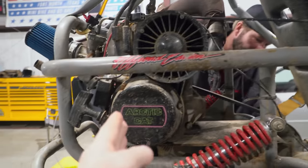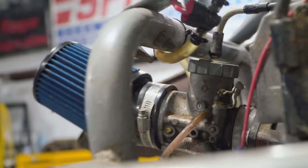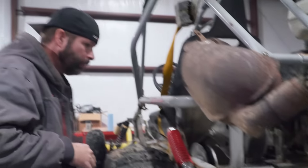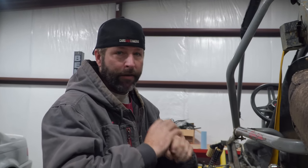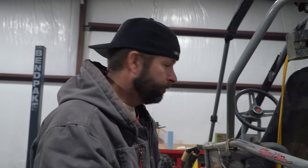The whole challenge today is in moving the engine forward and up because look at that carburetor spacing right now — it's almost non-existent. It looks like Ike is starting by taking the belt off the old torque converter setup. He's taking the bolt off the end, checking all the keyways and making sure everything's still lined up, because we could have another issue other than a slipping belt — it could be a pulley slipping on a shaft. KISS method.